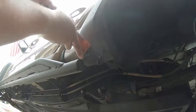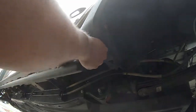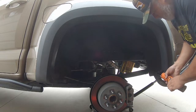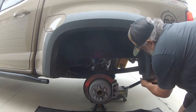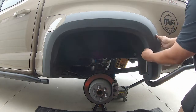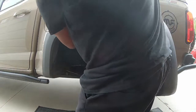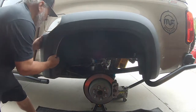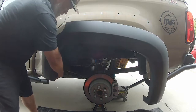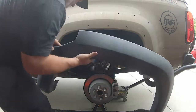The front of the fender has three screws and one retainer clip, and the rear has one screw and one retainer clip. You'll need to remove all of these to get the fender flare off. With the retaining clips and screws removed, go to the back edge of the fender flare and give it a nice pull forward — you'll find it comes off with some easy force. As you get to the front edge, there is a two-piece spat, so give yourself enough room and tip the fender flare down to work around the metal so it doesn't catch.